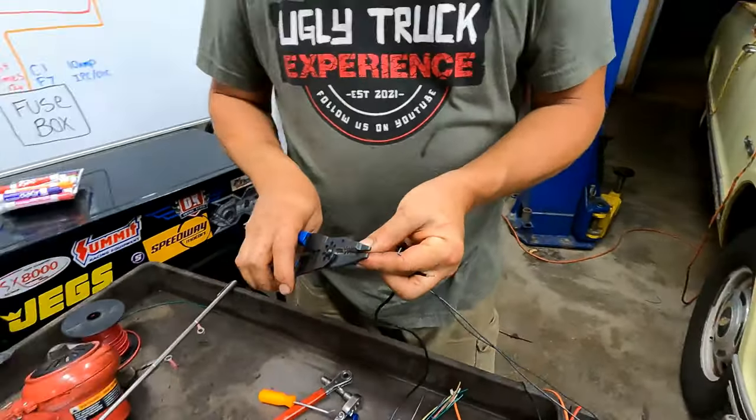And what we also need power for is our light bulb, our check engine light. Oops, sorry, Ben, I broke your wire. So for the check engine light, I'm also going to get power off of this one too. And it sits down right next to the ALDL connector, so I just put it right next to it.